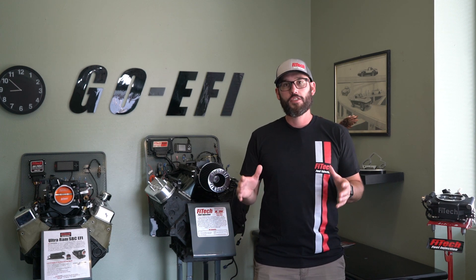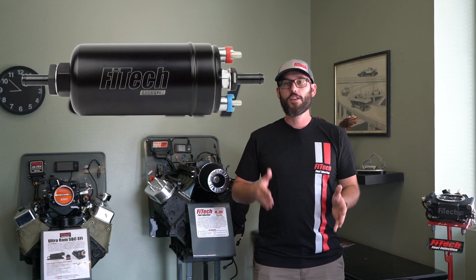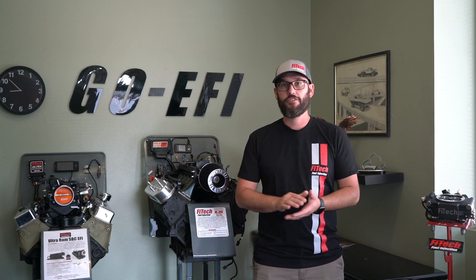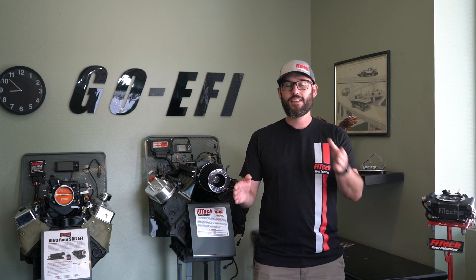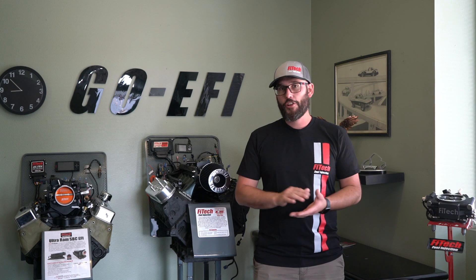When it comes to installing EFI systems onto your vehicle, there's an amp draw load associated to it. You have the EFI system itself, which will draw about 10 to 15 amps, and then you also have your fuel pump that will also draw somewhere around 10 to 15 amps. If we start adding amperage together, we need to make sure that this total number does not exceed what the alternator can output. So for an example there, we're looking at maybe about 30 amps.